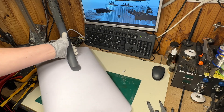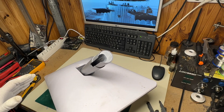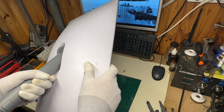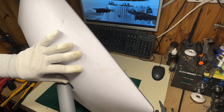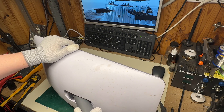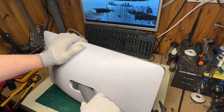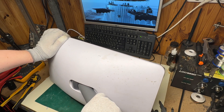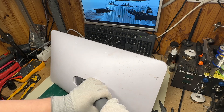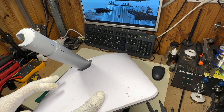In the worst case you can also lose the socket inside this tube, and it's also impossible to replace. There are no spare parts, but the main problem is that there is no way to extract the socket without fully disassembling the terminal. I don't recommend disassembling the terminal or damaging the housing — it will take a lot of time and there's no guarantee you'll be able to correctly seal it back. I saw that people are already trying to do the same modification but everyone is drilling holes in the wrong place and breaking the tightness of the device. Please don't make any unnecessary holes in the housing.